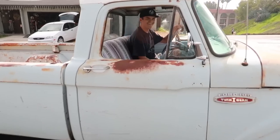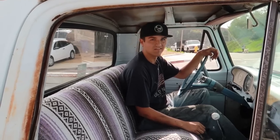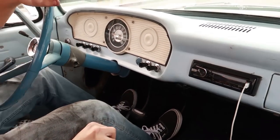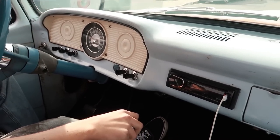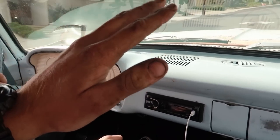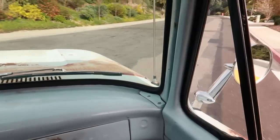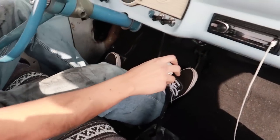So this was ridiculously difficult for us but it shouldn't be for you. If you need to do your clutch, it's actually not that hard — just use common sense and you can do it. How'd it drive? Way better. So it grabs pretty far down low — is that where you want it? Yeah. Because the whole point is, if it grabs lower, you don't really want it to grab at the very top because then the clutch will slip. But if it's down at the bottom, then we know it's fully engaging and it seems like everything works.